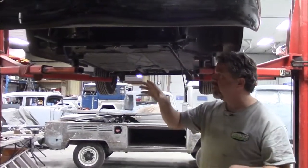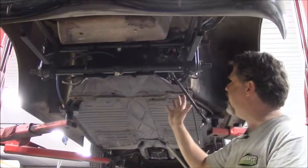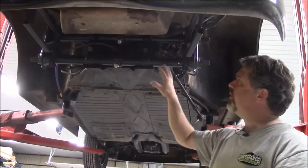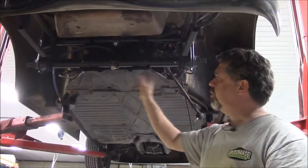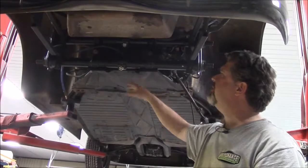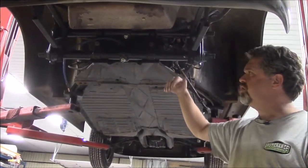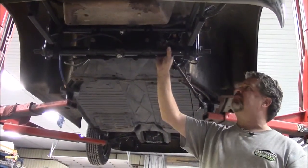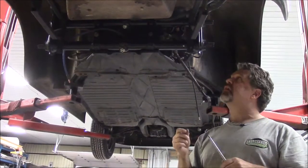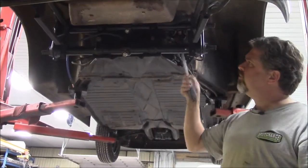One of the things you can see — and we'll share with you in some photos — the original beam. This is a replacement beam that we've just set in. We're dry fitting the front steering and suspension components because there are a lot of issues. The original beam that was in this car is out of an older Beetle, not a Super Beetle, just a standard Beetle. There are four main bolts that attach to the frame head, and we've purchased a top-of-the-line German-made adjustable beam. The beam that was with this Porsche was basically bubblegum welded everywhere, and in the main structural pivot points is where all the corrosion was — we could literally stick a screwdriver through the majority of the tubing sections on the original beam.